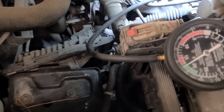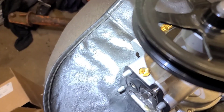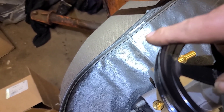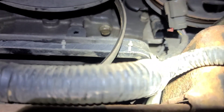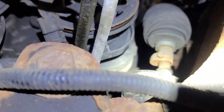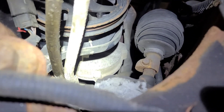So we're going to change that vacuum pump — there's a stretch belt on it. Here's the genuine GM part number, which comes with the gasket. If you slip a standard screwdriver underneath the belt and turn the engine over clockwise, you can walk the belt off since it's a stretch belt. There are three push pins that hold the harness and the connector to the cam sensor and cam timing solenoid. The harness is in a plastic guard that doesn't come out, so we're going to have to work around it.